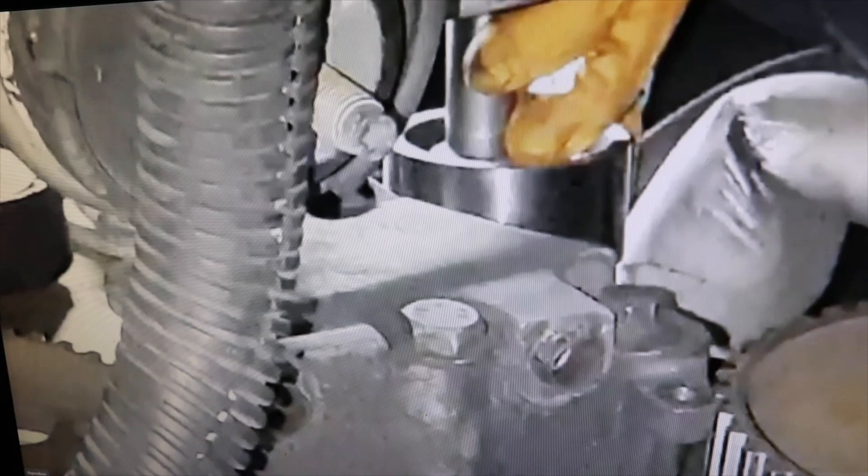The other day I made a video about the tensioner pulley stud of a 2000 TDI engine. It was a BKD engine; the BKP also has that stud and some others — I'll leave you the link. You can see how it was bent. It's not something very common but sometimes it happens, that's why I always say that stud you always have to change — you have to buy the distribution kit that brings it.